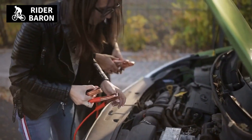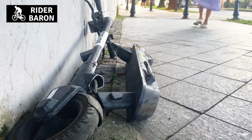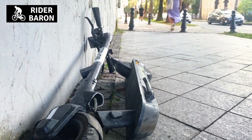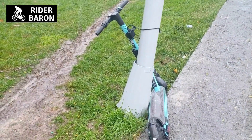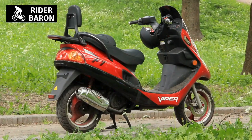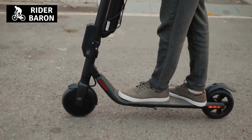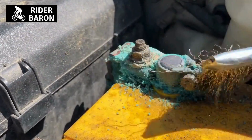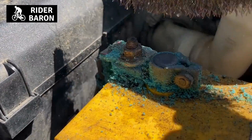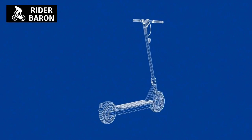My final thoughts. There are still many things to consider when it comes to kickstarting your motor scooter with a dead battery. If you can, the best thing is to get another battery or just pay someone in your neighborhood 10-15 bucks to push start it for you. However, if everything else fails and there is no other way than jumpstarting your scooter, go ahead and follow the steps I have talked about in this video. Remember to be patient when kickstarting a motorcycle with a dead battery because most of them require a few attempts before you actually get it going.